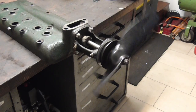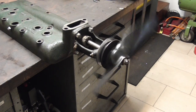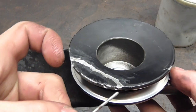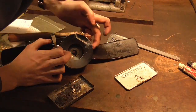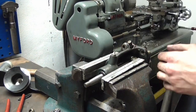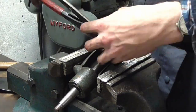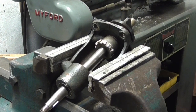Attached to the head is the water pump. I decided to replace the bearings because they didn't sound too great, and boy did it put up a fight. First, I wrecked the propeller blade while trying to pull it off the shaft. The fan is cast aluminium, so there's no welding. Instead, I glued and pinned it back in place, then gave it some rigorous testing to see if it would be fit for the job. And then I had to find out the hard way that the sealed bearing which goes in place of the original packing nut isn't actually threaded, only after some intense moments of increased force, that is.